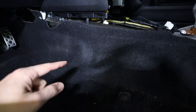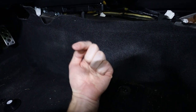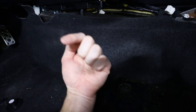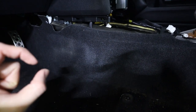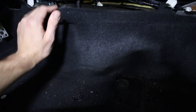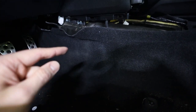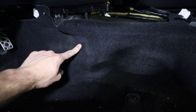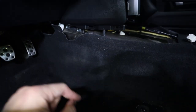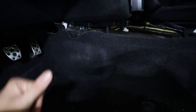And the way we did the mounting hardware is with the bolts sticking through on the underside of the transmission. That way, any additional length on the bolt that's not covered by the nut is basically just behind all of this padded sound deadening material, instead of if we did the bolts sticking through the interior into the underside of the tunnel, you might have extra material of that bolt sticking out, getting in the way of the transmission. I think that pretty much covers all of the interior stuff.